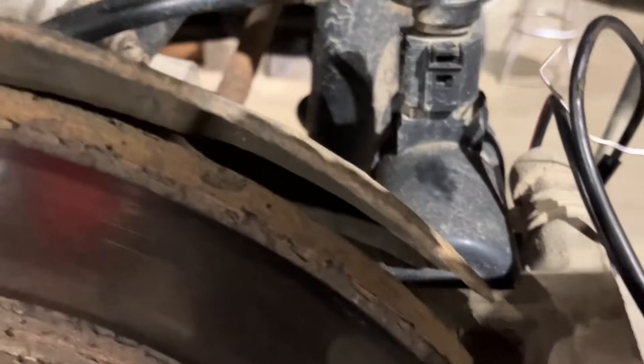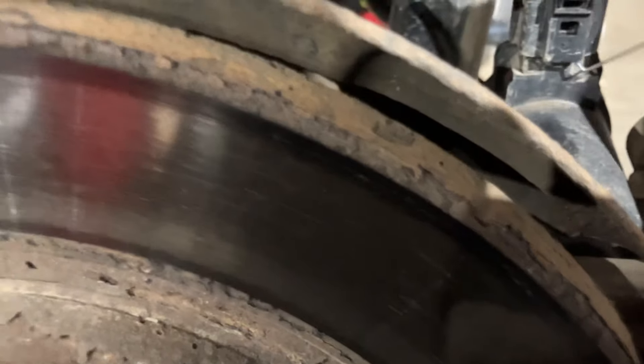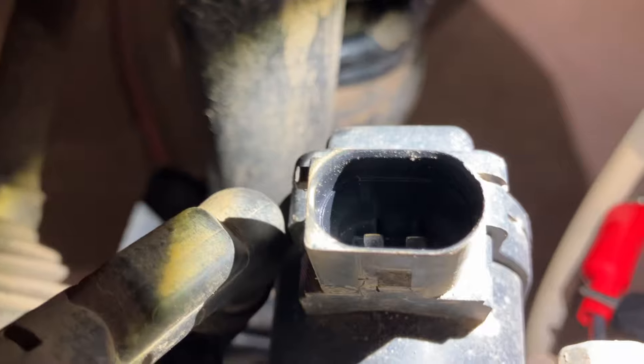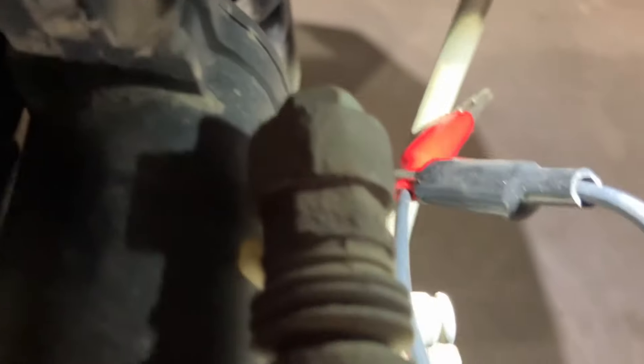This kind of connector here — I usually do this with all these. I got this bent paper clip, and I just pry this tab and off she comes. And if you look inside here, you're going to see two terminals. So basically, this is a reversible 12-volt motor. So if you look here, I have an auxiliary battery and some jumper leads.